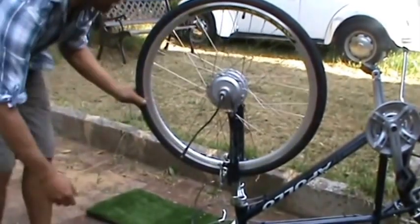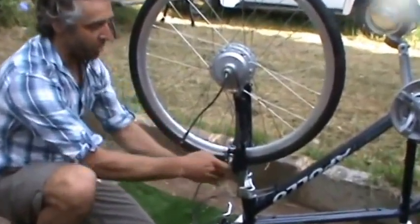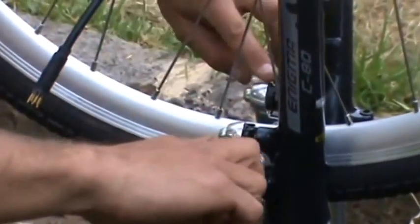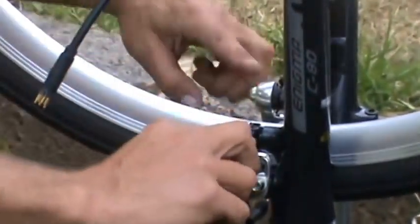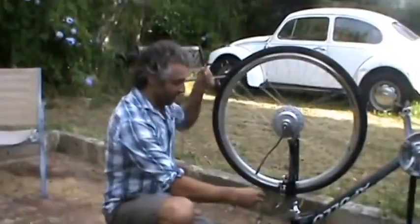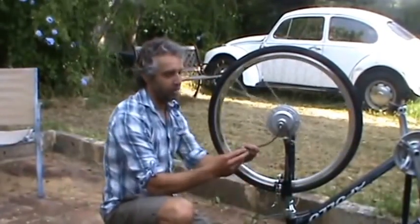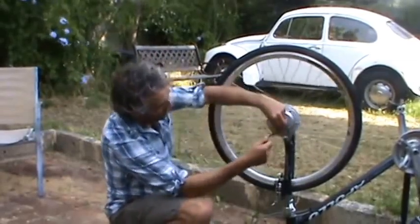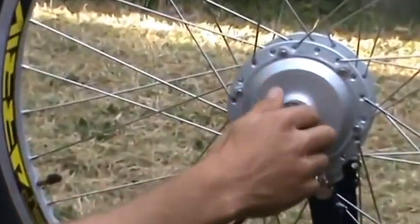The next step is just to adjust the brakes. Typically what you'll have to do is just align the brake pads with the rim, have it sitting nicely on the rim. Then you have little screws here — they work as pivots, so just align it with these screws to make sure it's nice and centered. Then you can adjust the brakes. These little caps here are a bit of a weak point, so it has a spring to protect it and also a plastic cap to protect it.